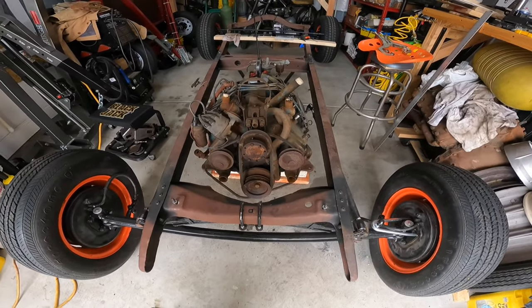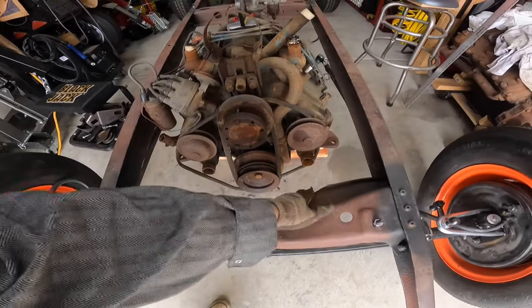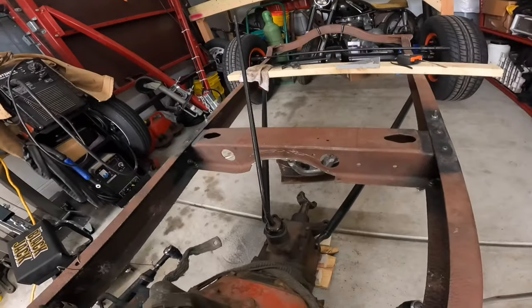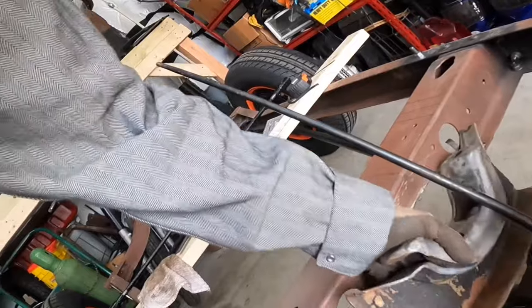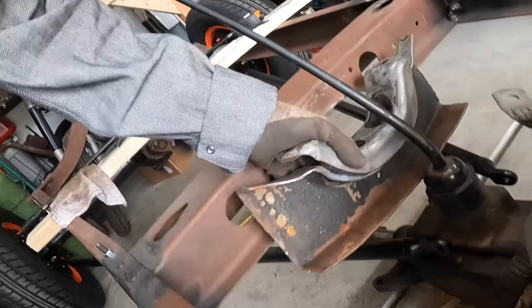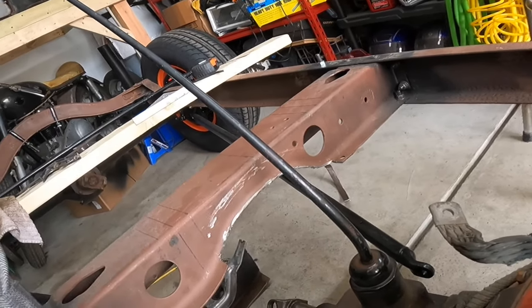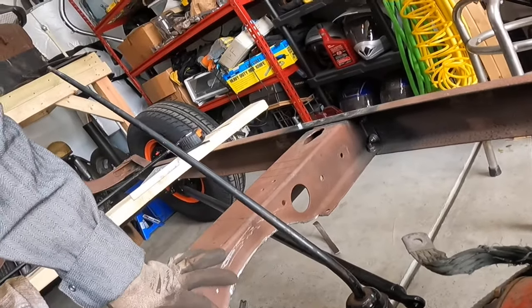That was about as much fun as you can imagine having hot metal rain down on you. I should have listened to my gut and clearanced this from the beginning. We've got that clearance now - we can roll back further, we have room there, and we've cut the flange off of our crossmember to give us where we're going to mount our drop bracket for the transmission. I just rough cut this out - it's still way too big but this opening here will probably get bigger. Our next step is to figure out how we want to make our drop bracket to hold this piece and start cutting that to size.